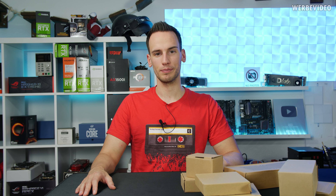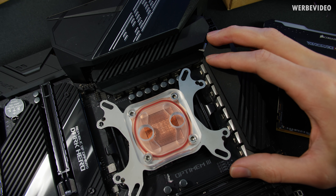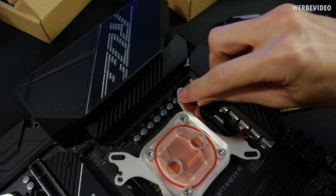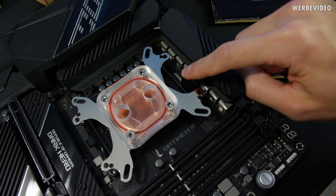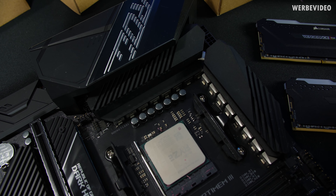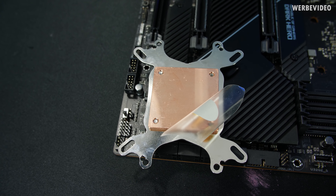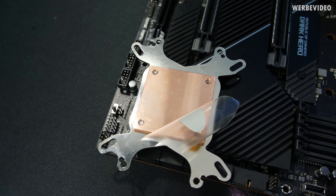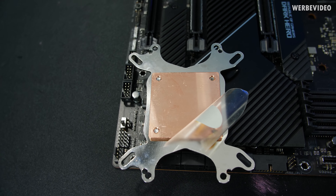The result is not beautiful, but it should work. The mounting plate appears to be stainless steel, which made it tricky with a small battery-powered drill — a proper machine would make it much easier. Using this universal mounting frame for the CPU block, there's some potential to touch nearby components. I see a potential issue with a capacitor nearby, but we'll check once the AMD stock mechanism is removed. As for the block surface finish, thermal paste should even out any small scratches.